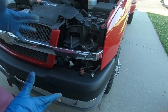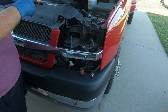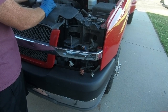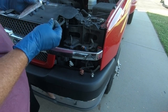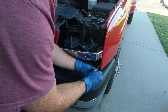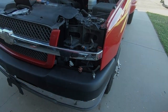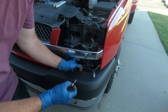So now we got those out of the way, let's go ahead, get a little dielectric grease here. And I've got my replacement 194s. Like I said, I'll list all this stuff in the description down below, but I'm going to put a little bit on it. Put it in place. And then I'm going to go grab the other bulbs. The only ones I have up here is the headlights. And I got the turn signal here. And I'm not putting a ton on these.